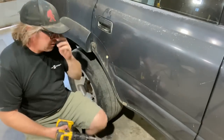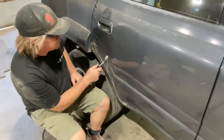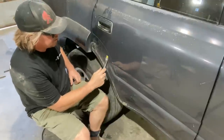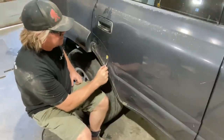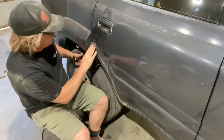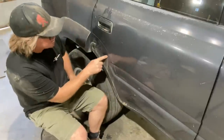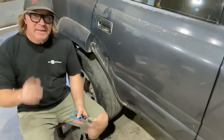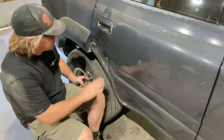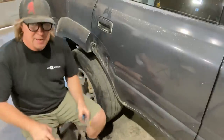Once you drill through the aluminum part of those rivets, everything falls right off. Then to get this plug out, you just get a body tool, pop it out. Most of it falls apart as you're doing that, and everything is out. You are left with a couple holes in the sheet metal. Two holes here, and kind of an oblong shaped hole there. That is something we will have to come up with a plan to deal with. There's a couple of different ideas of what you could do to fix that. We'll discuss that later in the episode.